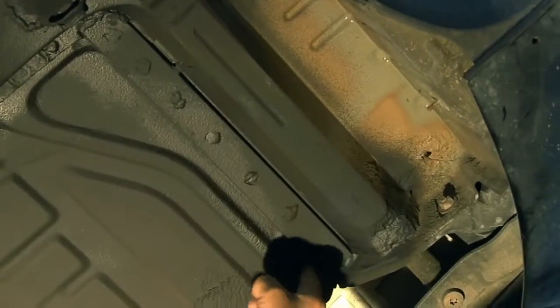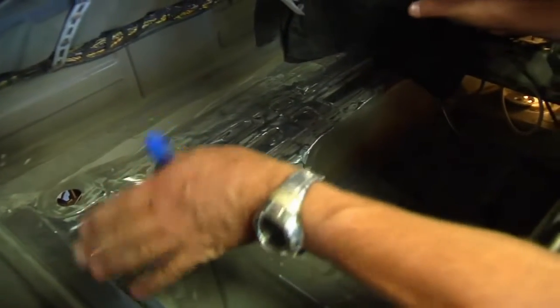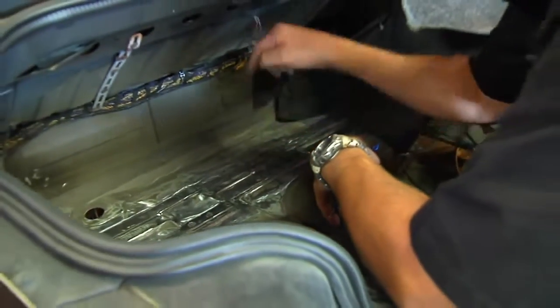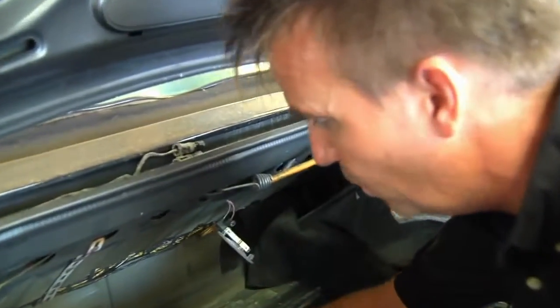So what we do is, as you saw from the bottom, we sandwich a larger, thicker material on each side of the frame rail so that it adds a support in the entire width of the chassis from frame rail to frame rail, and tie the center section in that the differential mount mounts to by welding gussets on, drilling through, and cherry butt welding it all the way through so that the entire structure is sandwiched together and we create a lot more strength.